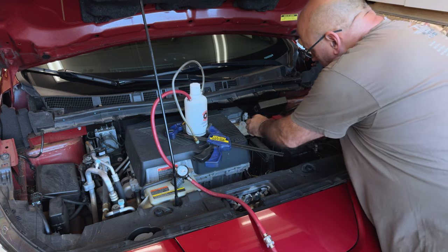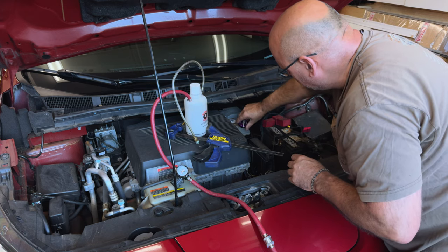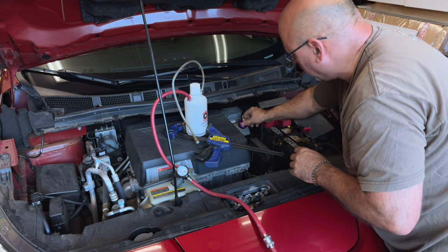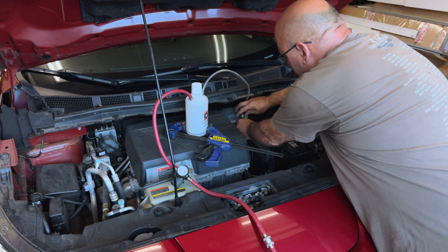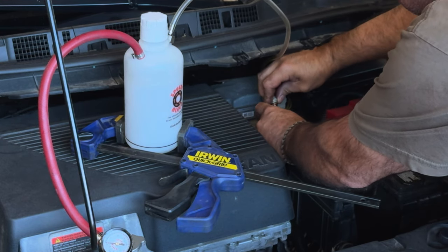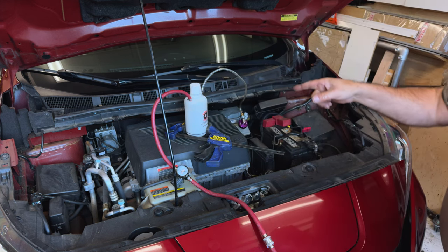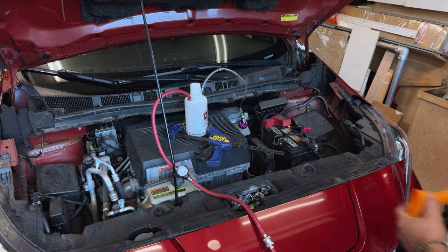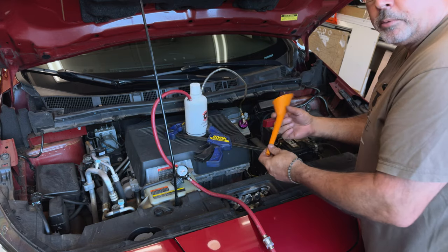A lot of people will say they've never changed their brake fluid. Well, it might not have a lot of water in it, but what condition are the additives to prevent corrosion and lubricate all the seals? I'll test that fluid. Make sure you keep track of that filter and that cap. I'll put the filter back in because there's no point in introducing dirt. Now we'll hook this cap up — it's actually a nice little design, just kind of pops on there and connects up.